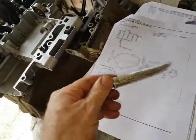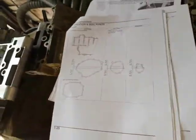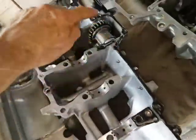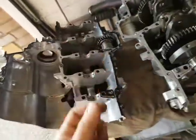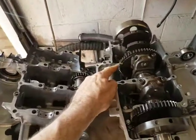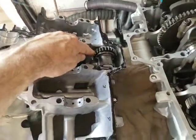This is the final video. I've used this special silicon bonding in the pattern shown in the manual, applied it and dubbed it round, then flattened it off my finger so there are no high points. If there's a high point it's going to squeeze. The important thing here was to show how we lined up the crankshaft cog and the balancer shaft.